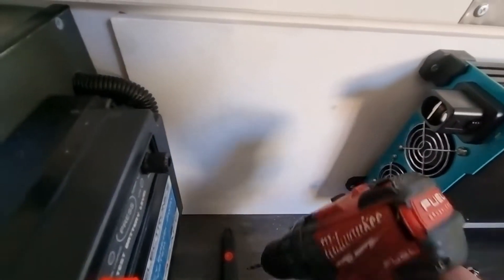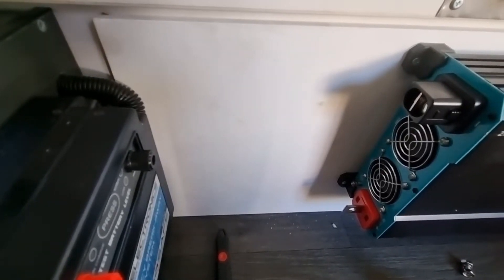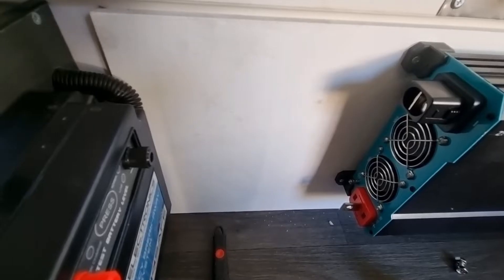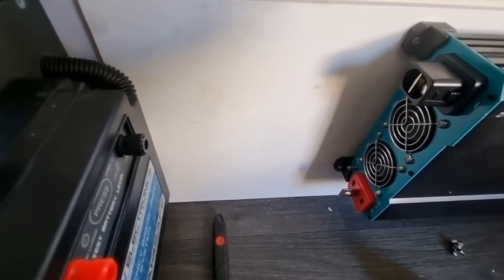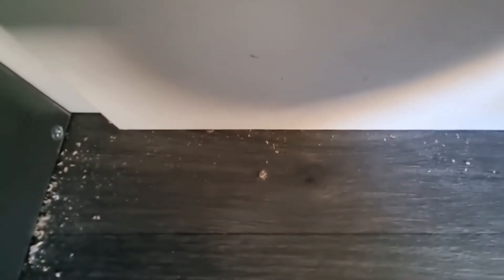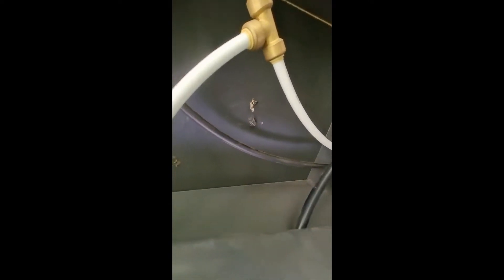Once you know where your cables are going, this is the scary part. I recommend putting a little drill bit through the floor first — don't go too deep, just enough to feel through the timber, which is only about 10 to 12 mil thick. Just do a small hole first so if you've totally stuffed up it's only a little hole to cover. Let's go check underneath the caravan and see where it popped up. You can see it's right there — I only went through a little bit then dropped the drill all the way so I could see underneath. It's going to go through here, through a gap in the chassis, and around to the battery box.